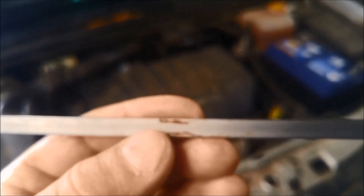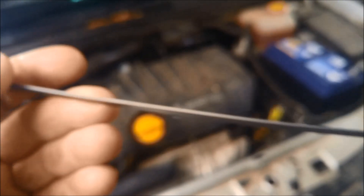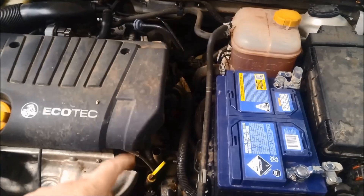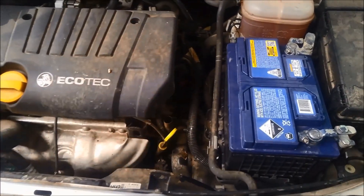I've got to point that out to the customer as well. You can see the rust is right up at the top there too, and that would be from the steaming effect as the transmission warms up. That's where it's going to rust. So that's from about just under half the way up the dipstick right up to the top.